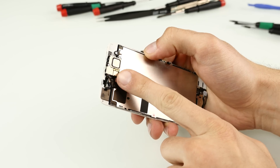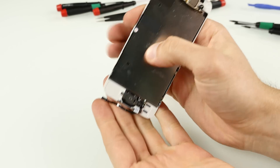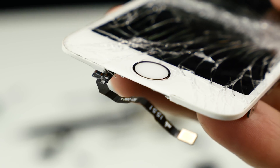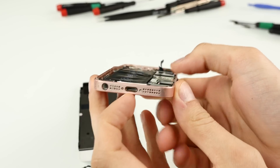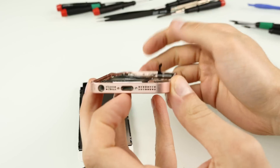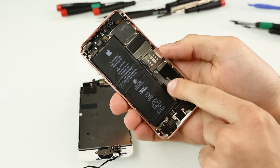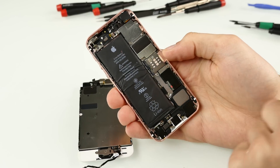At the top we have the whole unit for the speaker and everything — that's the front unit. The Touch ID cable from the home button is still attached, so you have to be really careful when opening up your iPhone. There are two pentalobe screws at the bottom of the frame. You unscrew those, then take a suction pad and separate the top unit from the bottom. It's actually easy to do, except you need a special pentalobe screwdriver. For a full rear teardown, iFixit has a pretty nice video on this.